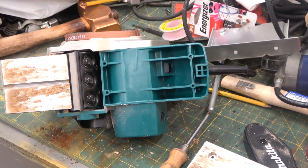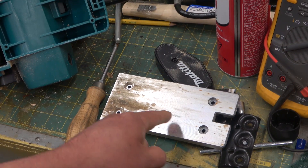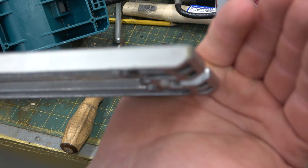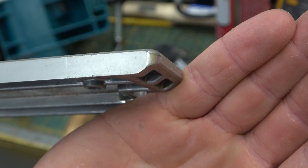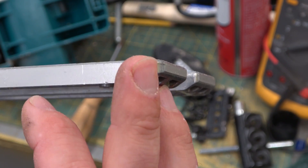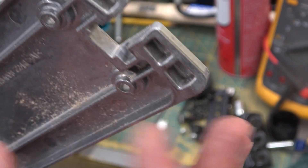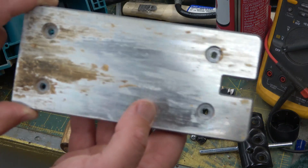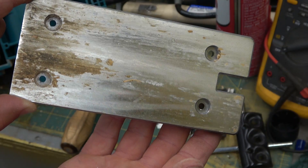There's the basal platen, straight die-cast aluminum. Minimum fly cut on the surface. You see a little programming error here — or maybe just an artifact of not giving any fucks. You see it comes along here, squares this off nice, and then misses this little corner, and then comes in here and squares that off nice. You'd think it'd just come around — there'd be enough material there to cut the whole thing — but nay. And then a big ol' fly cutter, just to get the surface.